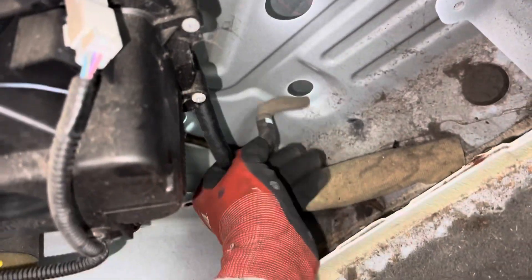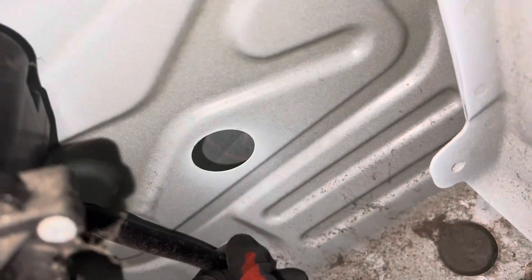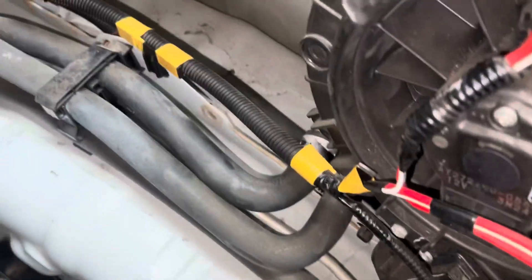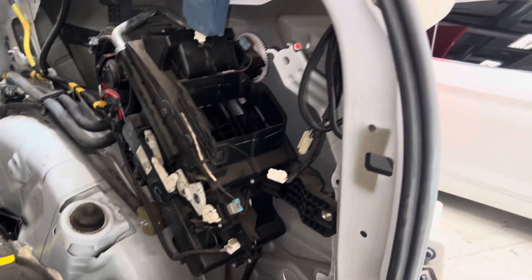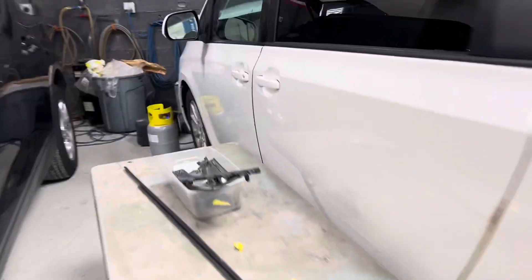Here's your drip tube right there. I have the system recovered and I'm going to fill it up with nitrogen because it's under a vacuum below 900 microns. Over here I'm about to add nitrogen to the system — it's at 858 microns — because I don't want moisture getting in when the tech disconnects the lines.